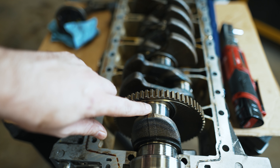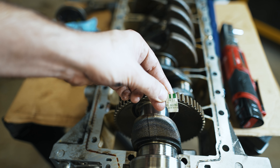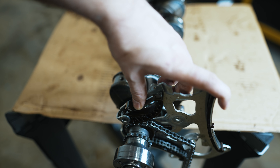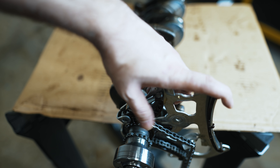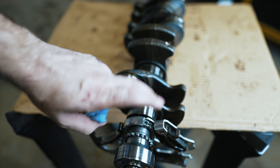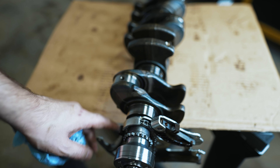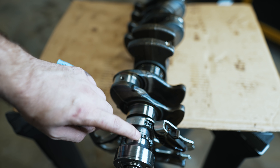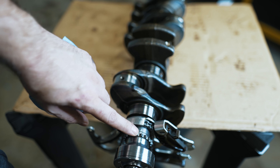As it stands right now, the King bearings I installed are actually a little bit more open than the stock bearings. But I'm seeing that you really want to be closer to the left side of the gauge on a performance motor. You'll know I replaced the rod bearings because the tensioner failed in my engine — it all shattered and I lost oil pressure momentarily. When this was failing, the engine was idling along warming up; the chain was dancing around and chipping pieces of teeth off, which could have been sucked up by the pickup tube and gotten into the oil pump. So we're going to move on to theory B: inspecting the condition of the oil pump.